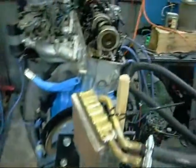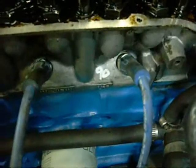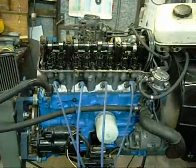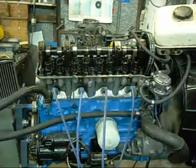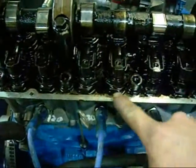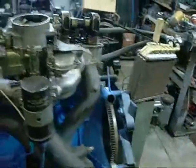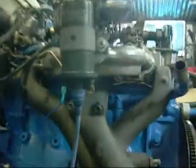That sounds much more consistent. I'll bet you that number one has much more compression too, because that was really tight. When I did the initial compression test I wrote it on the block — there was 90 and 120 for all the other three. I'll betcha that's a lot better now. Going to get oil everywhere because the oil pump works well, but at least I know it's working properly. I'll test fire this tomorrow — put the old pre-emission carburettor on it with a nice big sight glass on it, original coil. Yeah, it should work quite well.